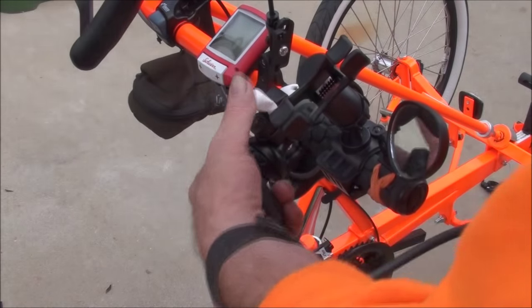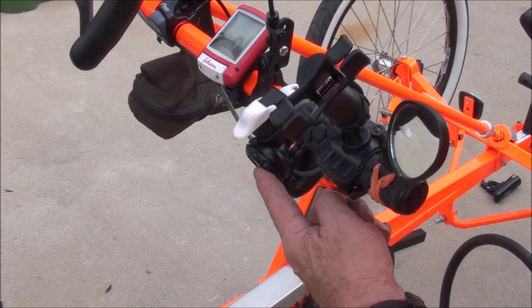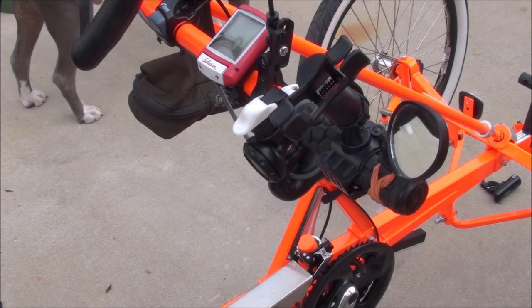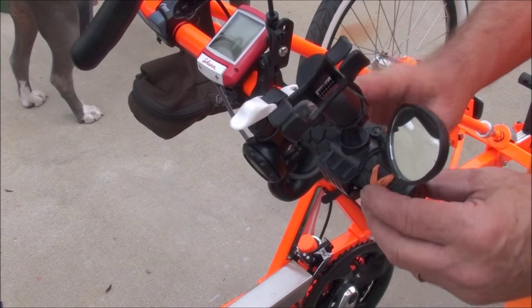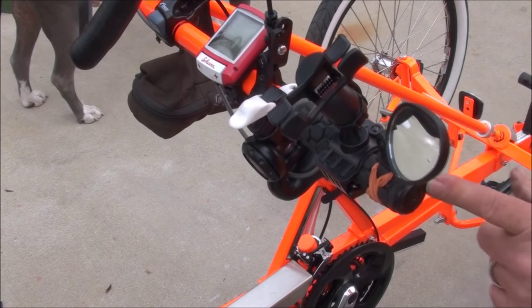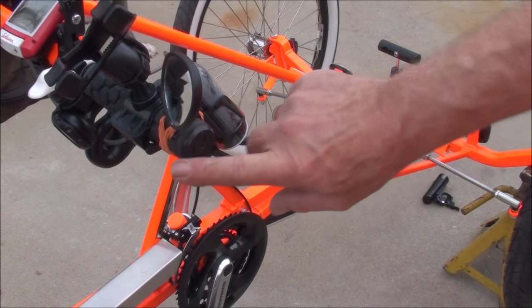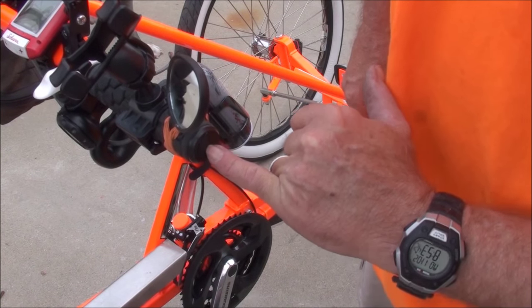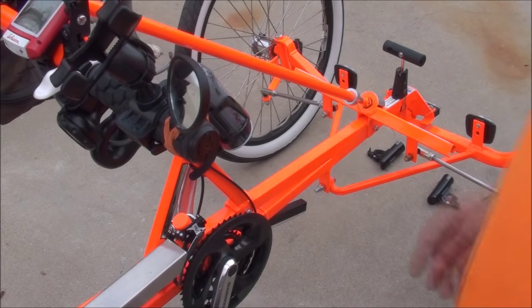Back to the compressor idea: the only thing is if you fill it with a compressor, it can go too fast and you can blow the diaphragm. If you blow the diaphragm, the horn won't work — all it's going to do is blow air. I'm going to be relocating this; it's a little bit loose and I've got to tighten it up. I'm also thinking about removing these completely. I do have caps — there's a little Phillips screw right there, you just loosen it and it pulls out. They're good caps. So I explained the air horn.